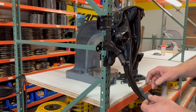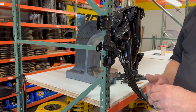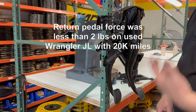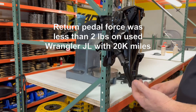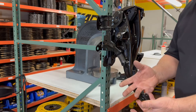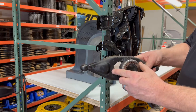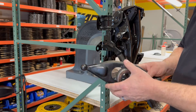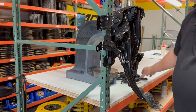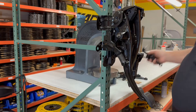We also noticed that over time — we had a Jeep with 20,000 miles on it — and the pedal barely returned. It was like less than two pounds pushing the pedal up. Some of that is the spring fighting it trying to come up, but there's also friction in the linkage: friction on the guide tube that the bearing slides on, and friction on the pivot points of the arm and the transmission. That contributes to the drag of the cylinder trying to push the pedal back up.